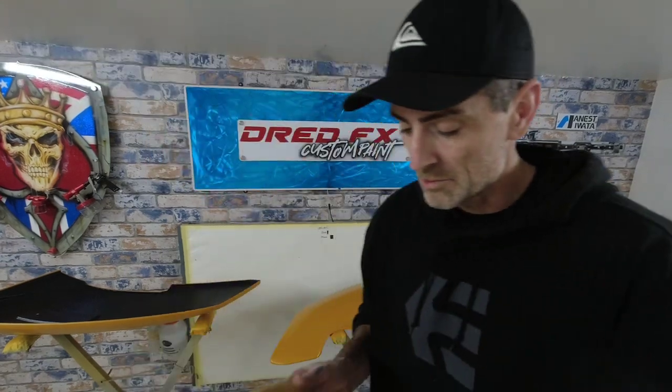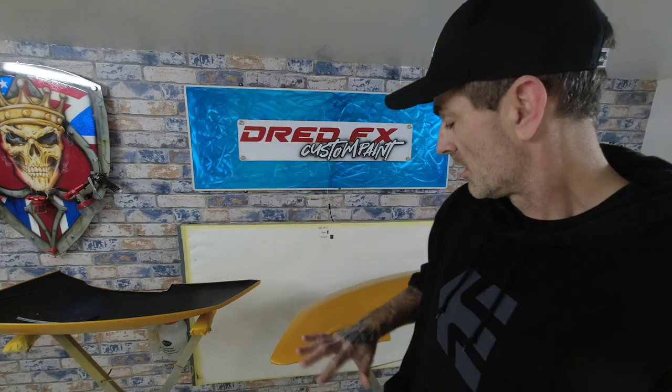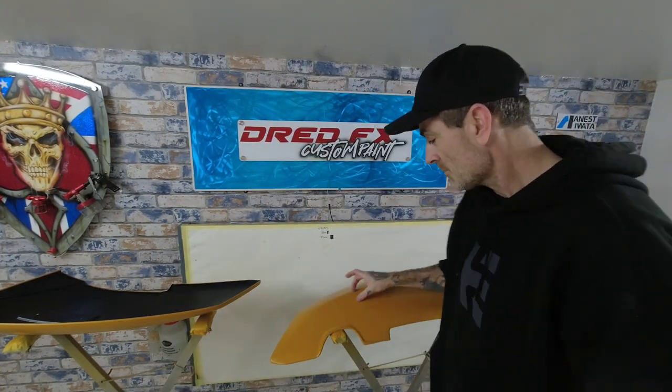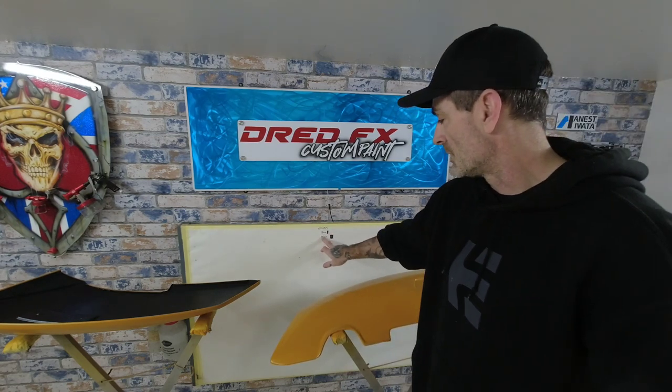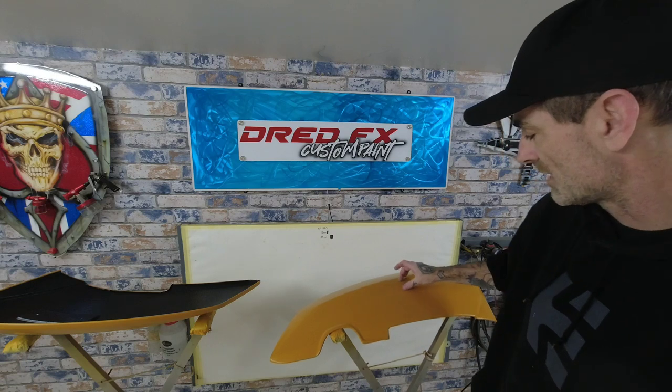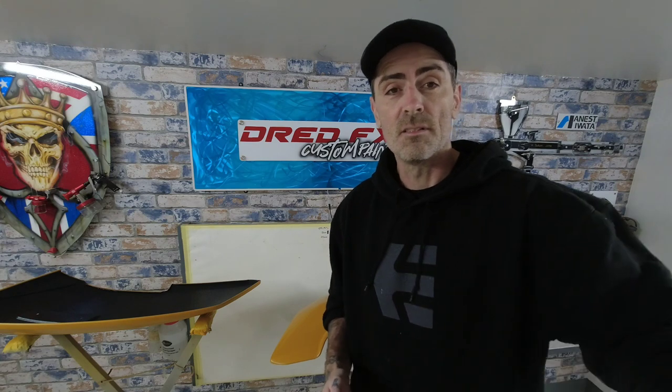We've got to get these panels looking like this. So we've got to do some textures across these panels, and then we've got to drop the original stripes in, which will be an 8mm stripe and a 23mm centre stripe down the centre of here. We'll use some fine line for that, and we'll drop some black base coat on. So I'll see you in the first time lapse.